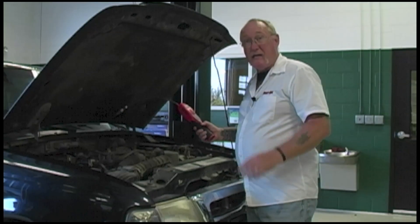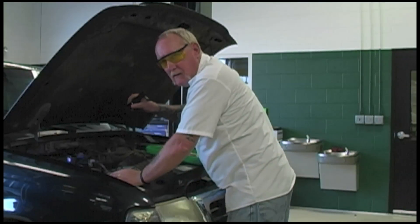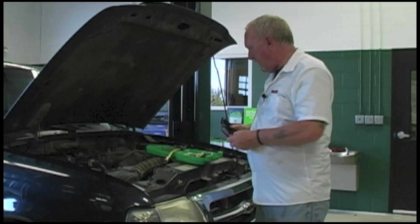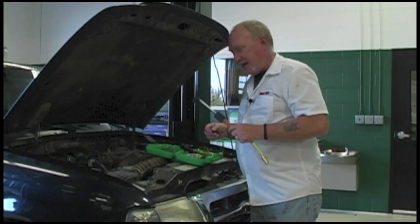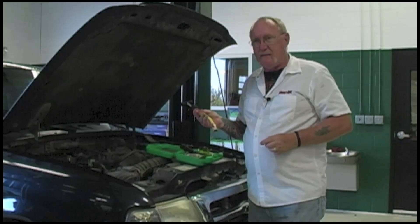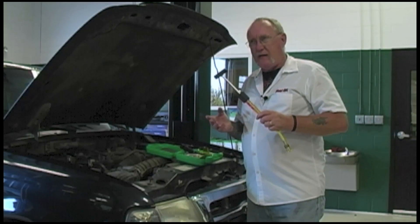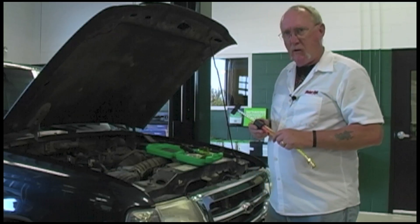If that doesn't work, I've got another tip for you. Couldn't find that small leak with your sniffer? Then the next thing you're going to grab is the dye. The use of a UV or tracer dye in the AC system has been a very common procedure we've used for some time now. But there are a few caveats you should know about using dye when looking for a very, very small leak.